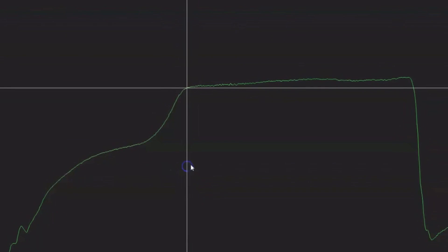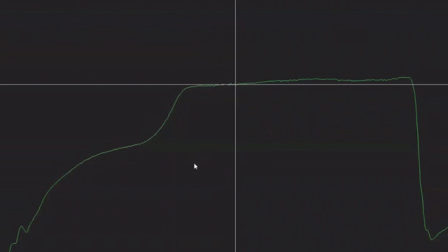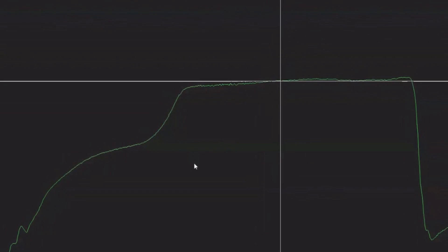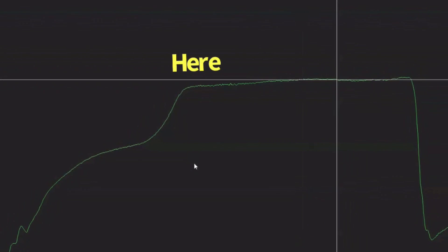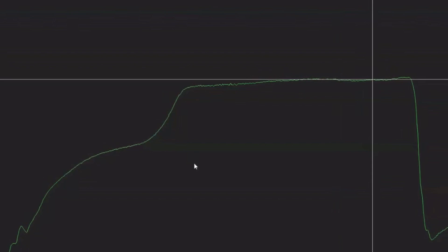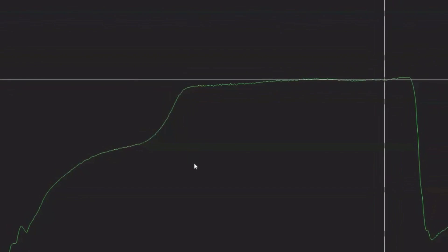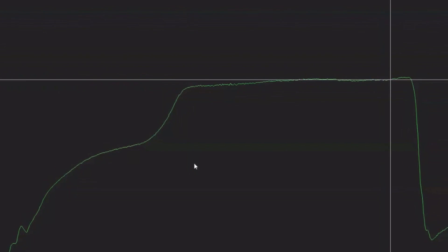Before the conclusion, I wanted to show you one of the Holley data logs. At the highest boost level — 14.5 pounds — once we loaded the motor, we started the run at 193 kPa and ended up at 198–199 kPa. That's only a 6 kPa rise through the whole RPM range, so the boost curve was fairly flat despite using a manual boost controller. The GT45 provided a nice, slightly rising boost curve, which I think helped us continue making power out to 6,500 RPM.